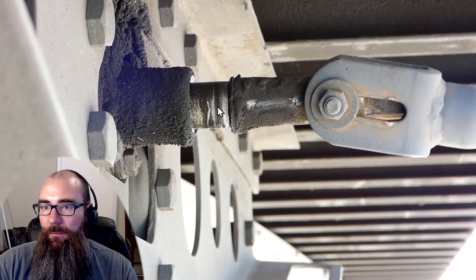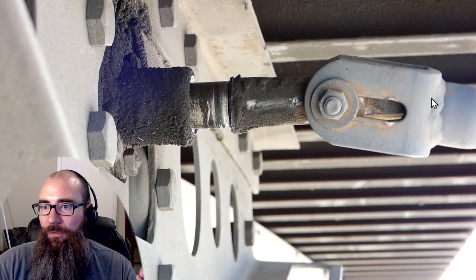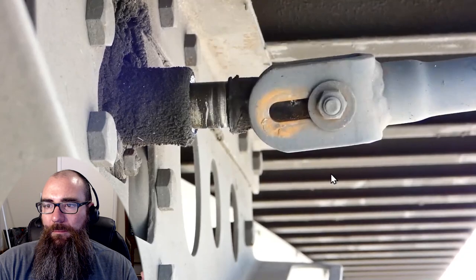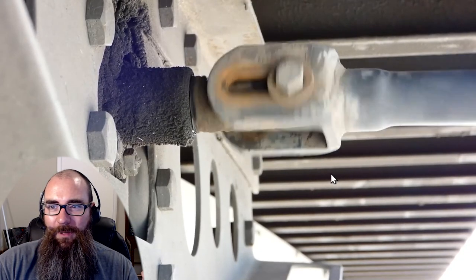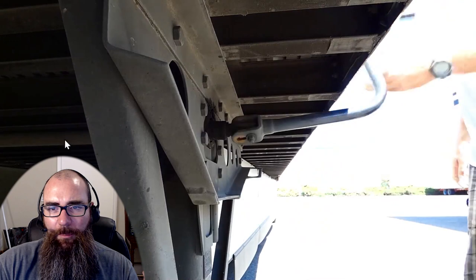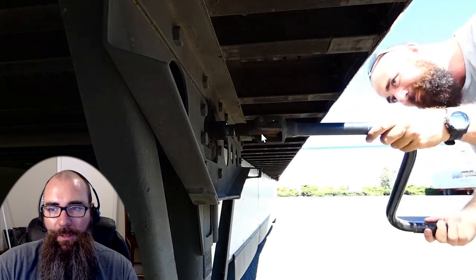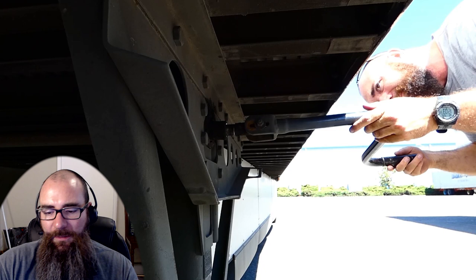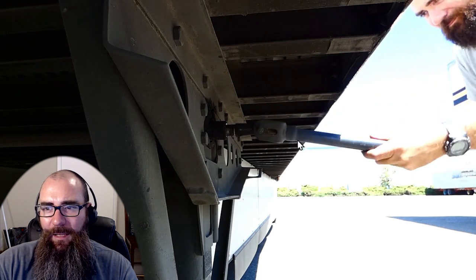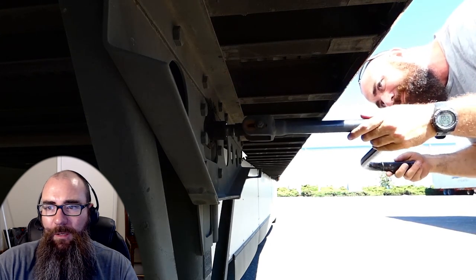Right now it's in low gear, but it's not connected. So you're going to have to finesse the little bar into here, because if you push it in too much, you're going to go right back into high. So kind of slowly put it in — and now it's in low gear. You can kind of hear the difference between high and low. What you can do is give it a little wiggle — if you feel nothing, that's low gear. Then your only other option is pushing it all the way in.